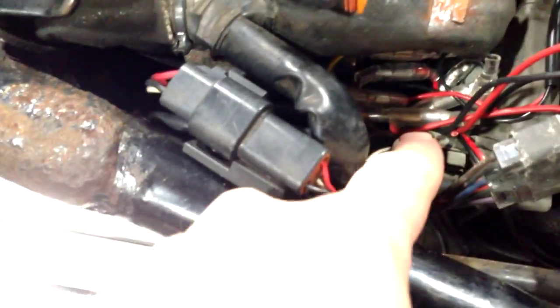Okay, another thing I did while I was waiting for paint to dry and such was to shift the resistor on the indicators from under here in the wiring. Try and keep this area here as clean as I reasonably can of wires. Which means down in here I have an absolute rat's nest of wires, which is all the connections on the resistor, connecting the rear indicator wires, which run through here from both sides. So we've got the two indicator wires into the resistor, which is tucked away down there.